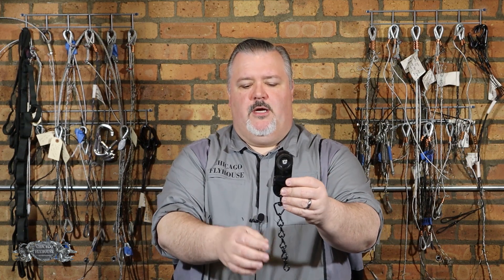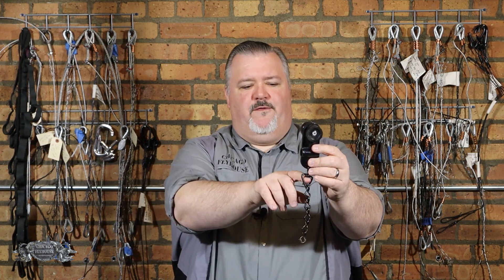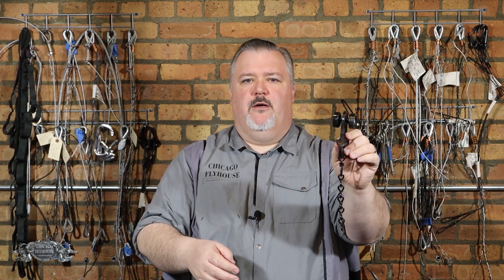We find that sometimes people load these carriers in ways that they're not really thinking about. For example, if I take a carrier like this and tie a curtain onto it — tying the first carrier while the whole curtain is hanging there until I get the rest of the carriers put on — that could put a lot of load on this carrier, and it might snap not in a regular load situation, but in an install situation.